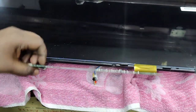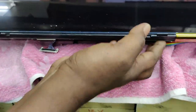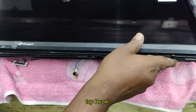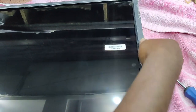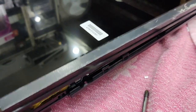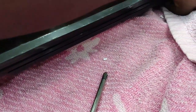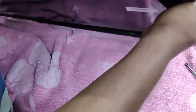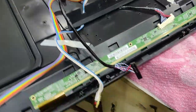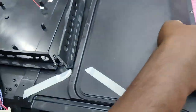Paste the tape and reconnect the scan drive board, getting them back into the correct position. Now place the final top bezel, press-fit it to the proper position, and take care that the LED panel is seated properly inside. Flip the TV gently to see the back side. At the back side, put all the screws — in this model there are a lot of screws. The scanner board is visible at the bottom.